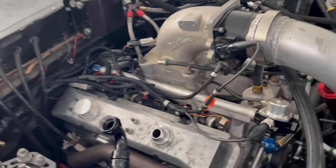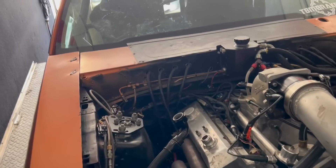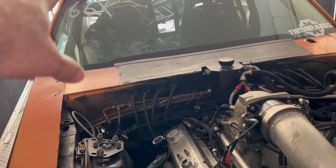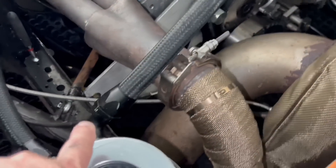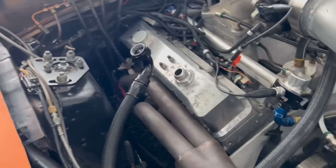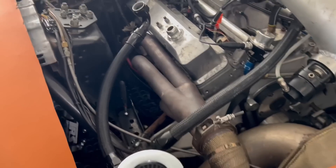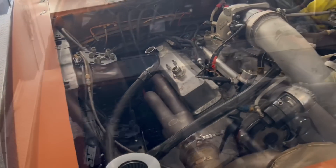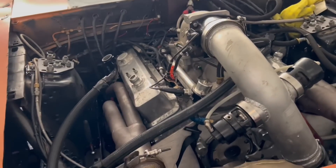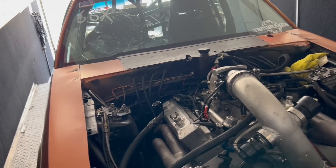Holley recommends attaching the coil ground straight to the head, and then you should be fine. Grounds are super important. The biggest ground I was trying to get to is the big battery ground. If your battery is all the way at the back and you just ground it back there and depend on the chassis for the negative — even with an aluminum mid-plate — there's a chance this thing is not going to ground properly and you're going to have a hard time starting the engine. If you don't have it done correctly, or if any of the grounds are loose or wiggly, or you're depending on the body to carry ground from the back all the way to the front, you're usually going to have some issues. Make sure you do it properly — the battery to the body is not a proper ground.